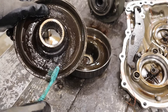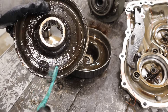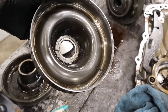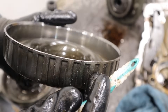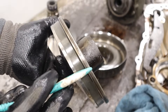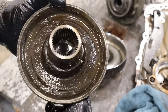I found something — there's probably clutch material or some other foreign material built up inside of the piston itself. It's like sludge inside of an engine. Let me shine this up so we can have a closer look at the surfaces. Here we have the cylinder — this remains stationary. I don't really notice too many vertical grooves, so this looks like it's in pretty decent shape. And here we have the piston itself. If you look on the side here, there's no rubber — it's actually just metal touching metal with the lubrication of the ATF.